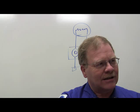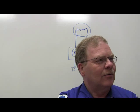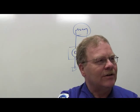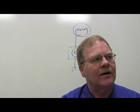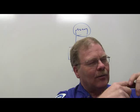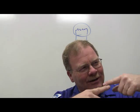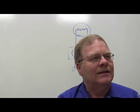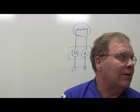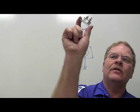When we pulled that coil, I mean, not the injector, the coil pack was being fed by wires that were rubbed in two, and it was making the number four misfire come and go. See, and we disturbed it when we pulled it out and put it back in, and there was enough of that insulation left where that copper was touching. You know, and then you'd move it and it'd go away. And so anyway, I had to fix that right quick the next day when it came out on Friday.